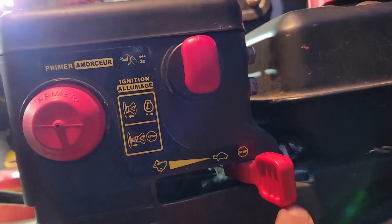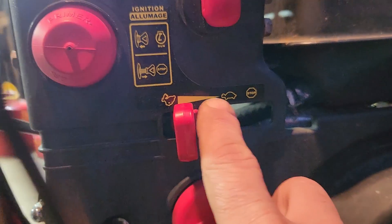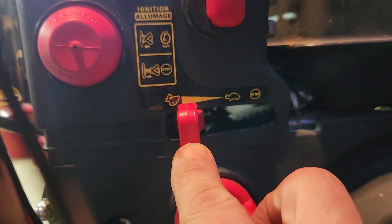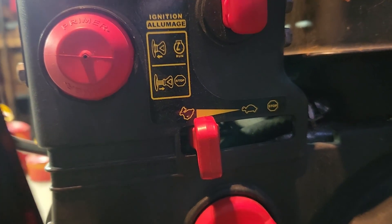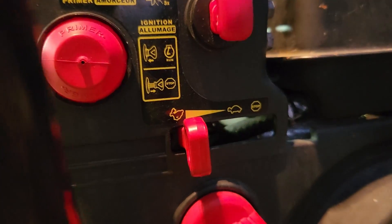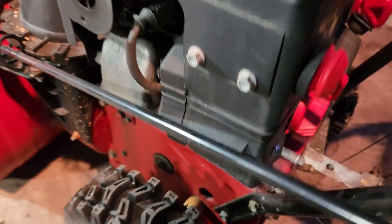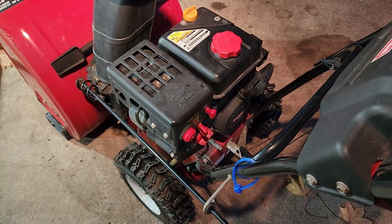Take a look at the front side. Here inside is a screw that adjusts where the throttle slide is — it adjusts how far it can go. It's set so it can't go nearly as far as it should. It's only getting somewhere just shy of 3,000 RPMs, and I'm looking to get 3,600 RPMs.